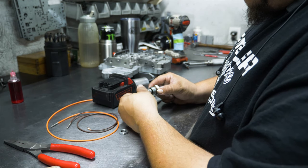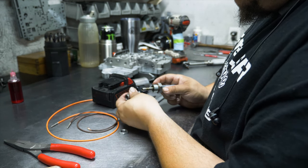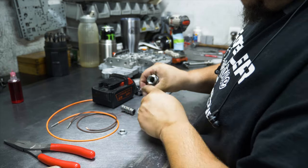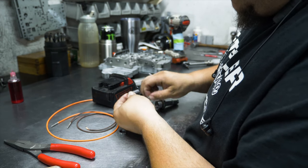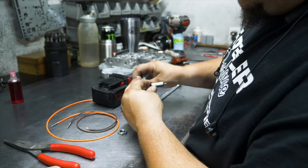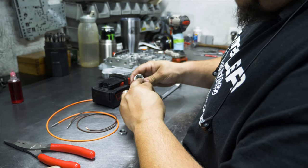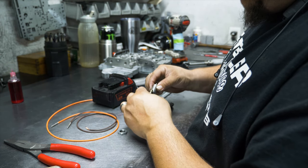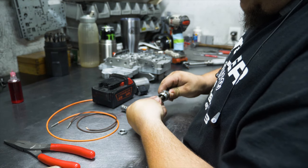spin this thing off, and this part of the valve moves really freely. So I was like, well, that's not really an issue because everything seemed to be fine there. But then when I went to pull on this bullet that sits down in here, it was super, super stuck, and it was about everything I could do to get it out. Finally got it out, and there must have been some junk that got down in this bore to where this thing wouldn't move back and forth freely. So I took a little bit of Scotch-Brite down in there and cleaned out the bore, took this thing back to the polisher and polished it up, and now it's a whole lot better. So I have it to where that thing moves in there the way it's supposed to now.